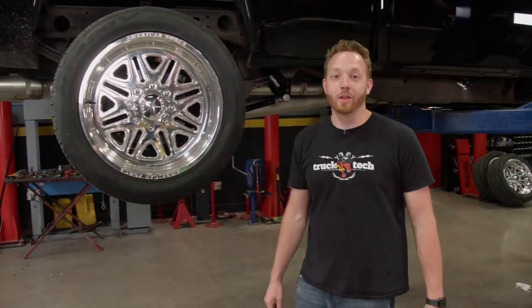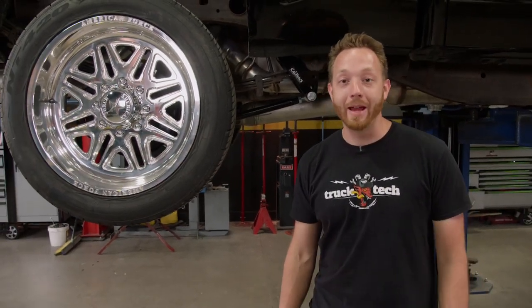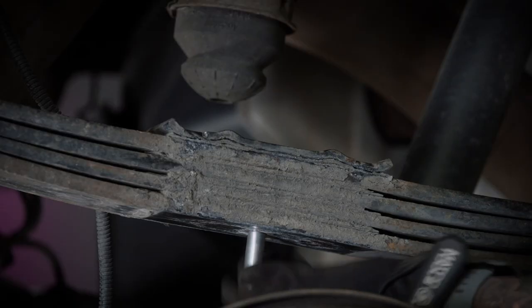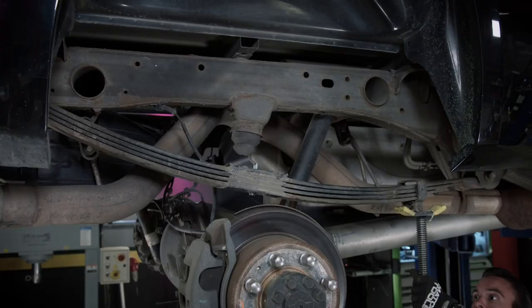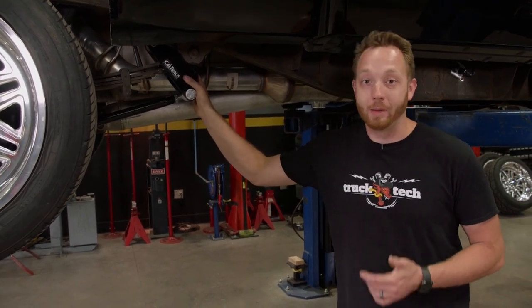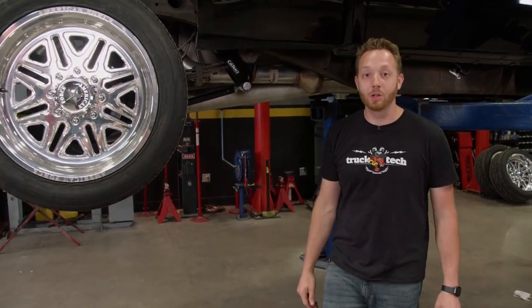If you're going to be doing any sort of racing with a diesel pickup truck, more than likely you're going to be spending time at the drag strip, since these things are so heavy they really can't corner on a road course. We've made a few changes to the chassis and suspension to help put this torque down without spinning. We rebuilt the rear suspension, lowered it three inches with a drop shackle, and removed the overload leaf spring for one additional inch, but that introduced a little axle hop. To combat that, we installed a set of Caltracks traction bars, which eliminate axle wrap and wheel hop, and also force the spring, axle, and tire down into the pavement. And to remedy remaining traction problems in a boosted launch, all we have to do is switch it into four-wheel drive.